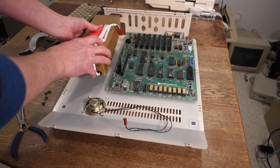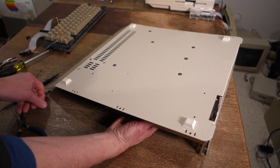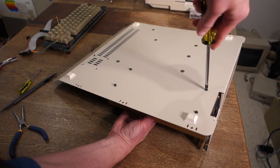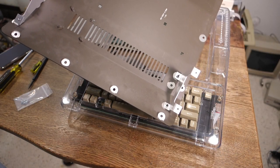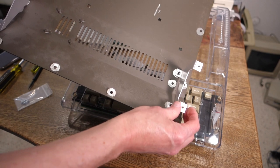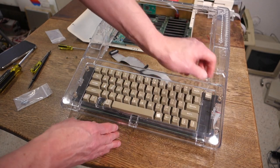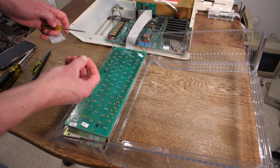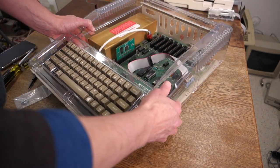Next let's put in the power supply, which is held on by four screws. The easiest way is to flip the case over, line it up, and put in the screws — using the screws that came with your original Apple IIe. On my old IIe there were metal mounting brackets for the keyboard that were screwed into the bottom of the base pan, and I thought I'd need those for the new one. But when I tried it, I was actually able to just screw the keyboard into the attached mounts on the clear case itself, so the brackets aren't needed. I'm using the machine screws that came with the case. The last thing to do is plug in the keyboard and then assemble the case.